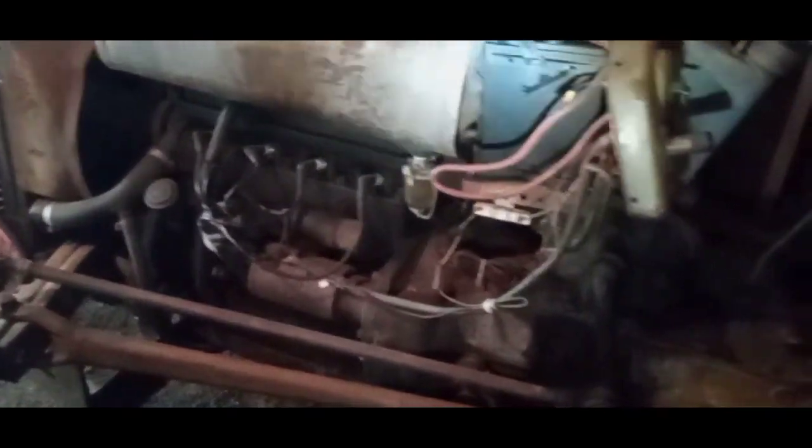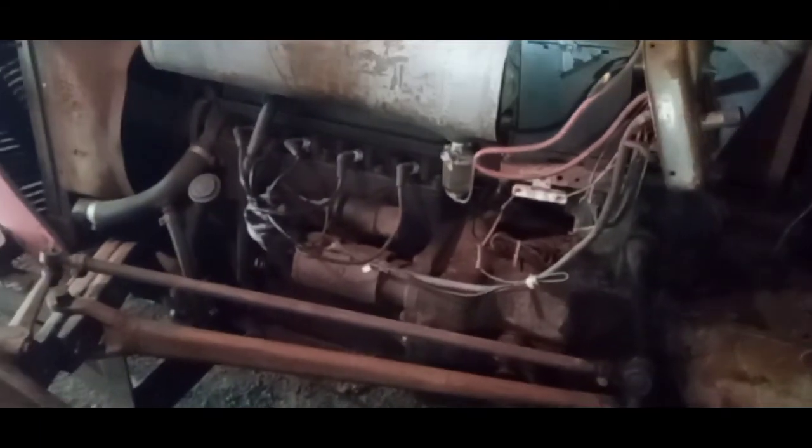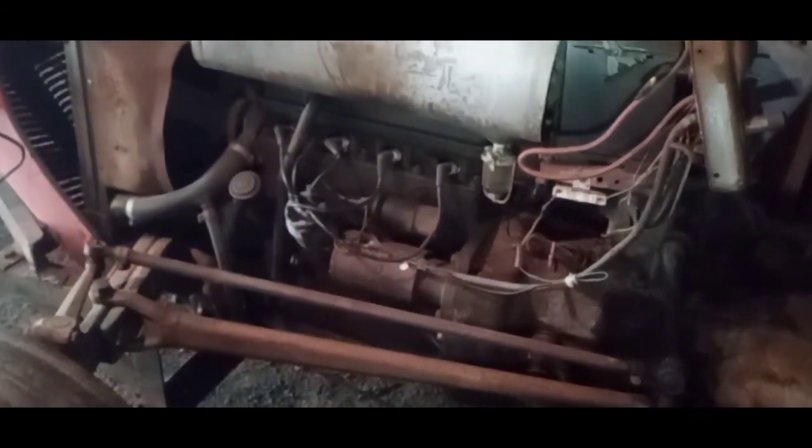After opening the fuel shut-off valve, you have to wait a couple minutes to make sure gas drains down in there. There's a fuel water separator right here. Looks okay. Got your starter button, choke. Problem with taking video of this is that it takes 2 hands to start it, one for the choke and one for the starter button.